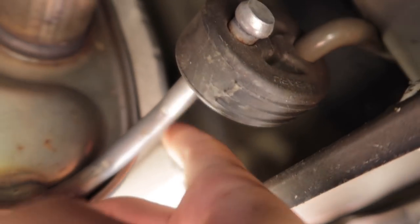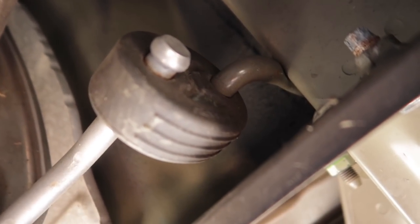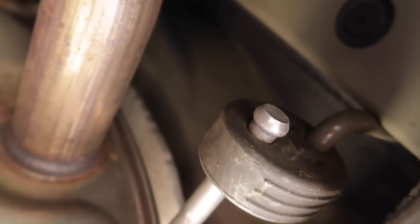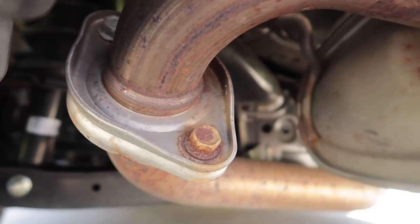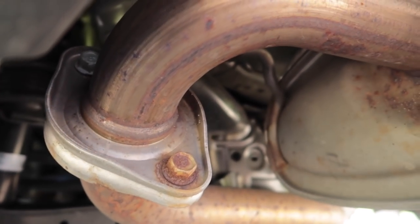Here's what we see under the car. There are rods coming off the muffler — they look like this — that are held in by these rubber thingies. You don't really need any tools to take them off; I'm thinking we're just going to be able to bend and pull them off. But I believe these are the main bolts that hold in the exhaust system and the muffler.